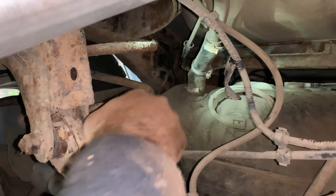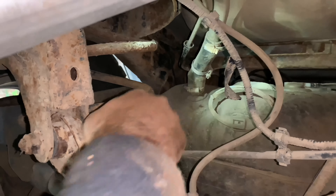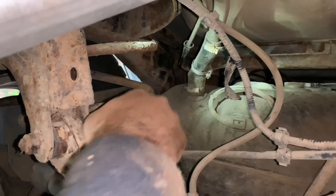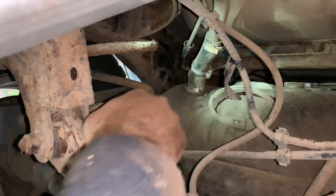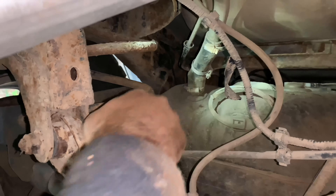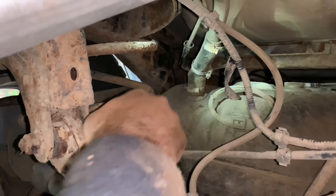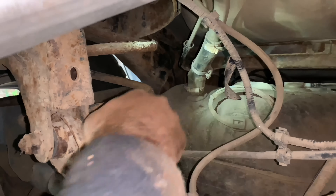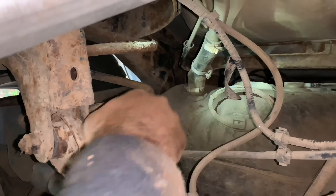This is how big the gas tank is. This is the heat shield and this is the gas tank — let me show you guys what it looks like just as it's been pulled out of the Durango. It is one big piece. It's about at least a good three and a half feet. The part we're about ready to replace is right here — the fuel pump — because the engine is getting no gas to it. The next step is to take the actual fuel pump off of the tank.